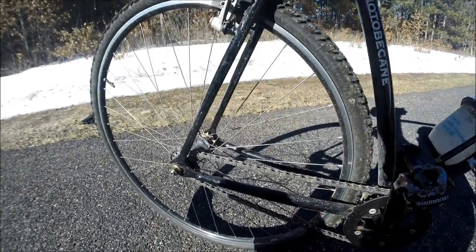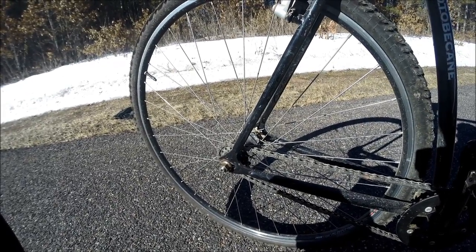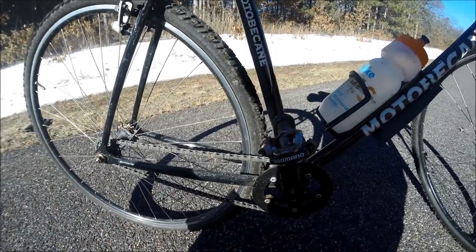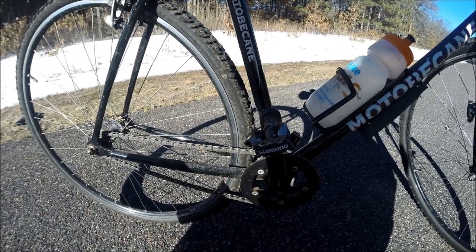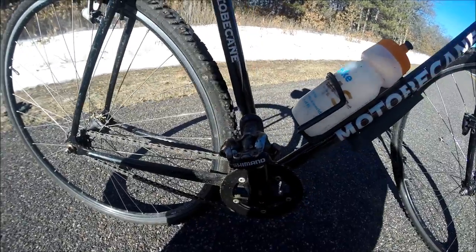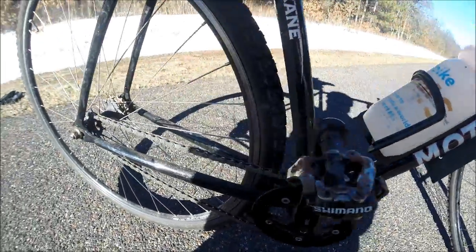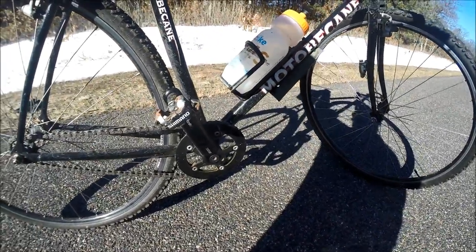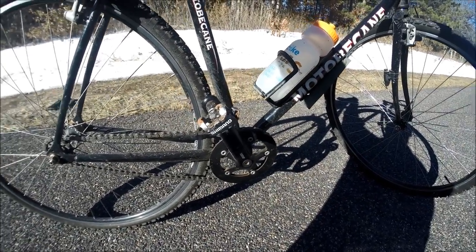As you can see, this has no derailleur for shifting gears — no extra gears. There's just a front gear and a back gear. So there aren't moving parts to get rusted up. And you can see the rust that accumulates on here — on the pedal there, and down here in the crank. So my winter gearing on here is 38/17, and in the summer time I flip that — I've got another one that's a 38/16 that I put on there.